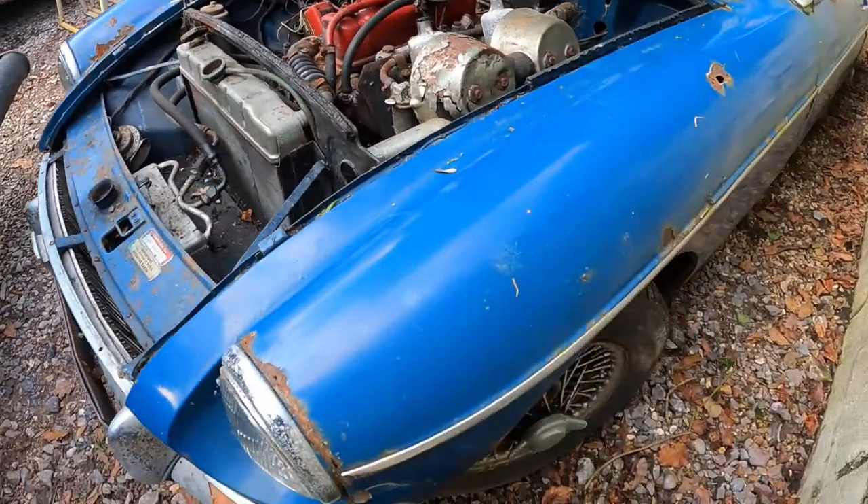We've just stuck the battery charger on and linked that up. I'm going to put a bit of extra juice in and see if that'll be enough to turn the engine over. We couldn't get the engine turning over today, but we're going to get a new battery soon and try again. We think there's possibly a problem with the starter motor or the solenoid — there's no life there at all. But the engine does turn over by hand so we know it's free. A little bit more exploring into the electrics and we'll bring you that in the next video.